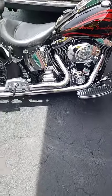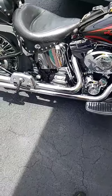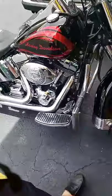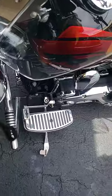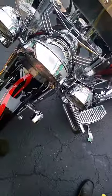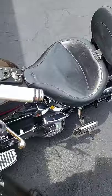Well, one of the first things to do is check the positive and negative connectors to make sure everything's nice and tight so there's a good ground, and your crank sensor. Last week, we replaced the crank sensor right down there. It ran. Everything was operating according to plan. And then after they took it back out for a ride, it did the same thing and shut down altogether.